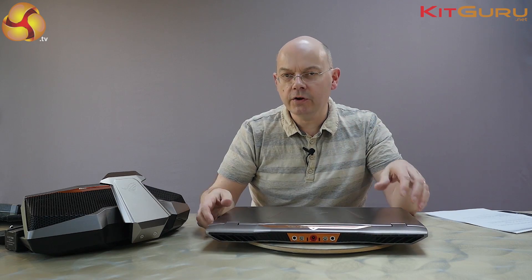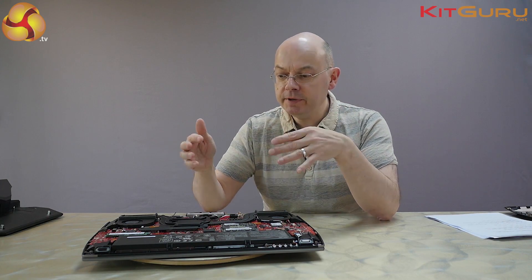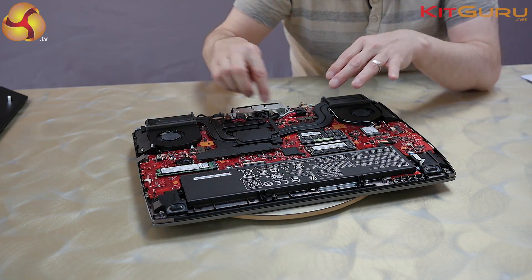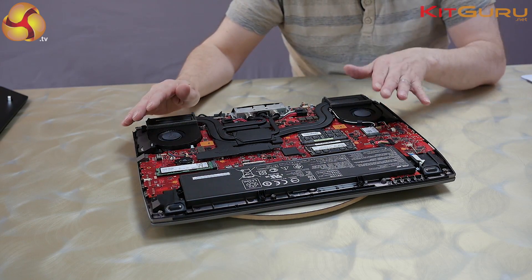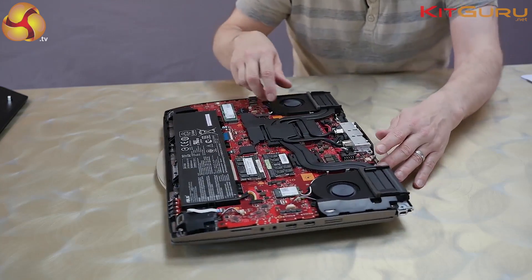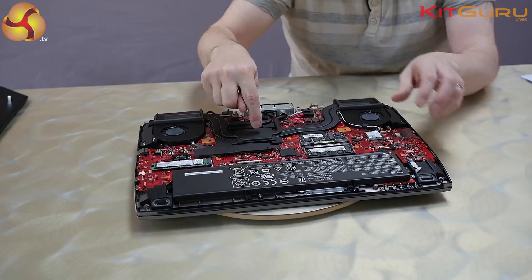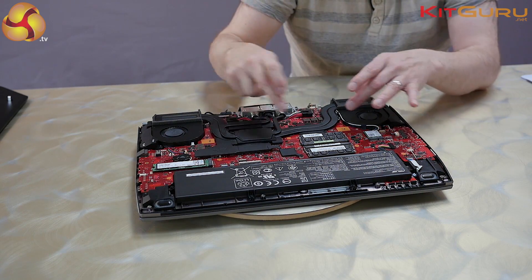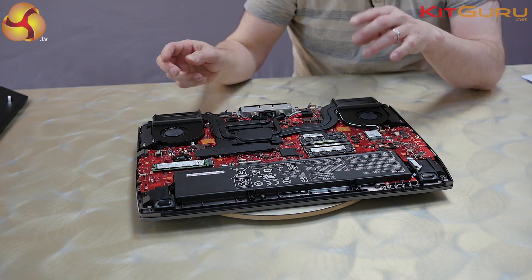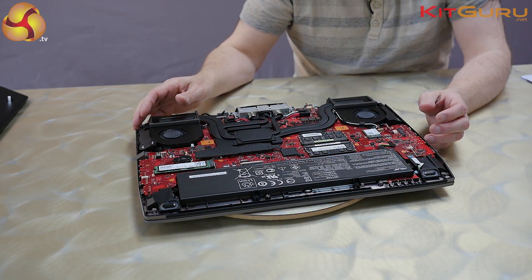Once you pull off the bottom cover of the laptop to reveal the innards, pretty much everything becomes clear. We have the regular heat pipes and two coolers which we'd expect to see in any large high-performance laptop, exiting to the two sides. And then we have this extra bit - this is what it's all about. The liquid comes in and out, flowing through this pipe, and there we have a liquid cooling block taking heat from the block beneath and transferring it to the liquid system. Very neat - they've packaged the two systems on top of each other. When you don't have the liquid cooling dock connected you're using these heat pipes. Plug that in and you've got extra cooling. Very nifty.